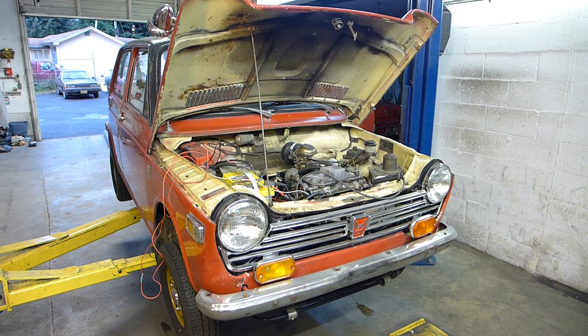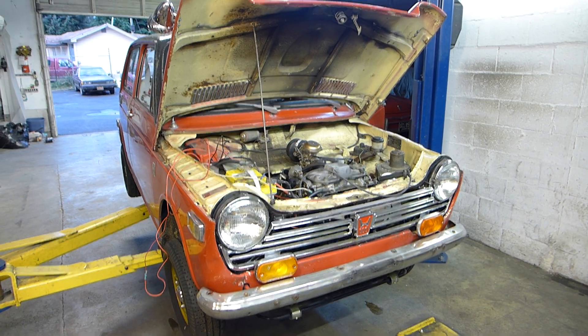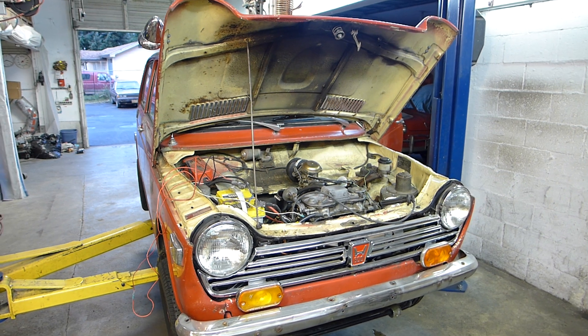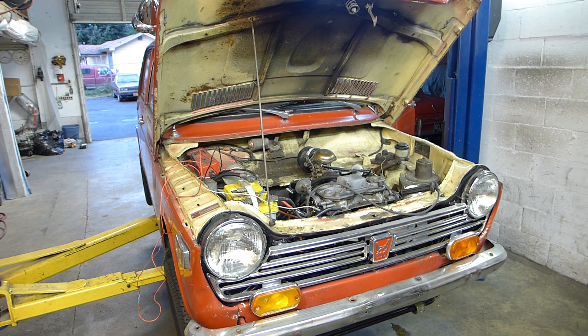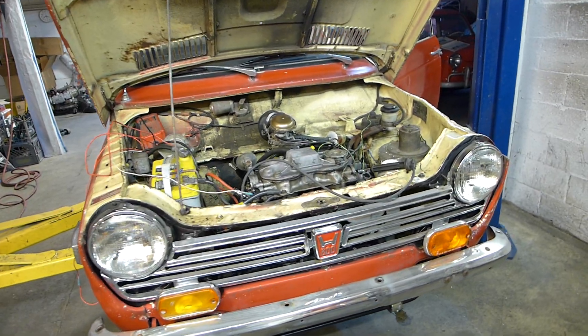Recently I've noticed that it's had a high RPM miss somewhere near redline. It seems like the redline has actually been lowering — it used to be 8,000, then went down to 7,000, now it's about 6,000, and it's actually been bumping around 5,000. So it's a little difficult to diagnose some of those things sometimes.